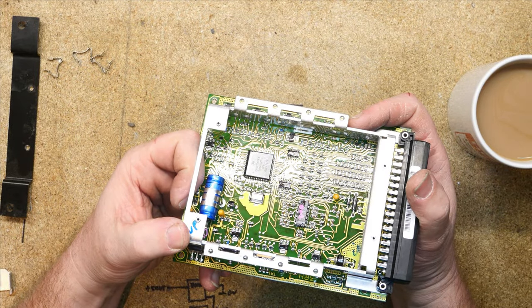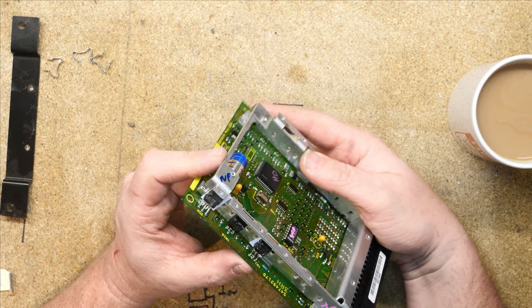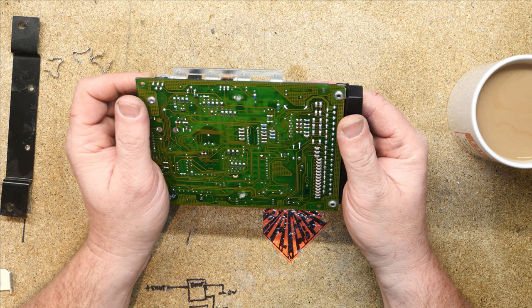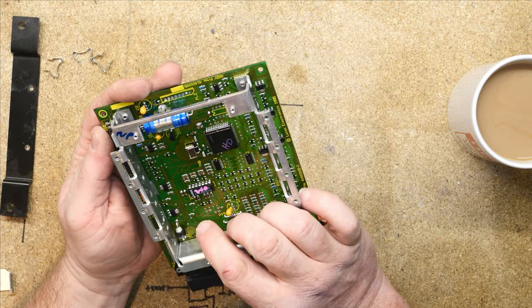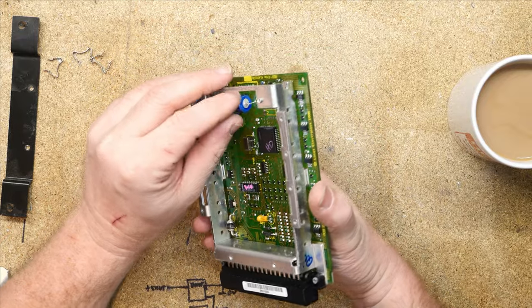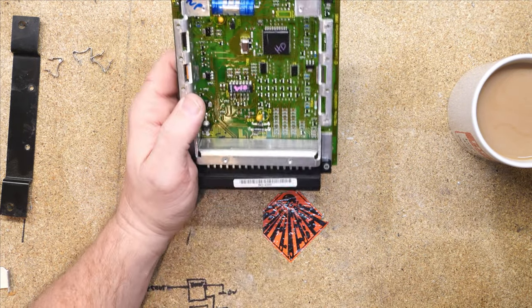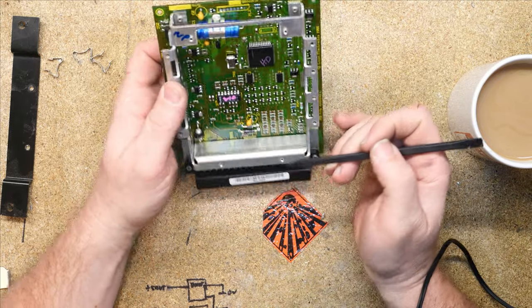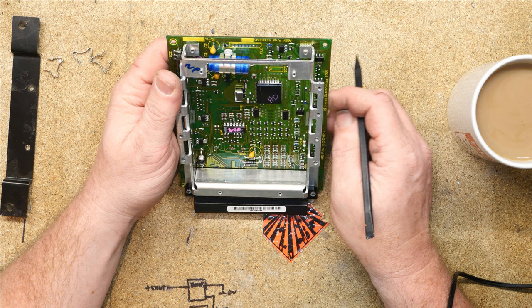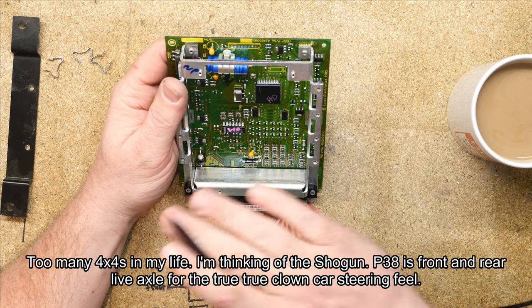We've possibly got two voltage supplies here. That one looks more like a traditional transistor-type setup with a base resistor, and the drive comes from somewhere over here. There's really not a lot on here — it's conformal coated and everything is restrained. There's less than I thought there would be. The LM324 is being used to condition or amplify — or both — the signals coming from the potentiometers mounted between the chassis frame and lower suspension arm, which tells the controller what height the wheel is at.